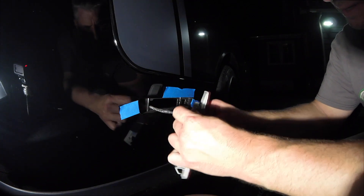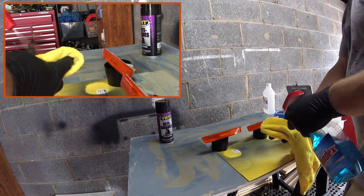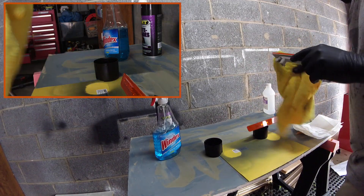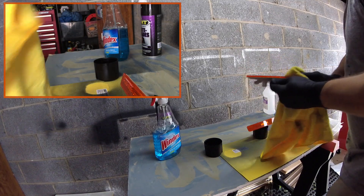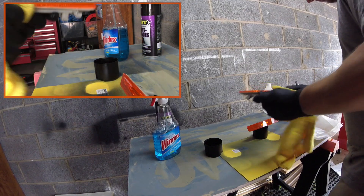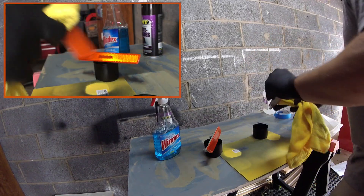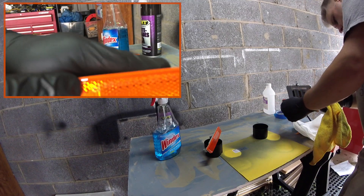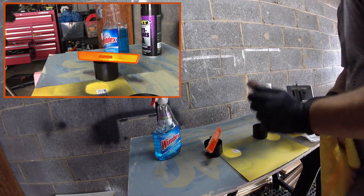Unplug it just like you did in the front, and simply repeat the process on the other side. We've got two layers of cleaning here. The first one is going to be some Windex, an ammonia-based cleaner — scrub all the dirt and goo off, anything that's sticky like road tar. I'm using a microfiber at first, then a paper towel. When you're cleaning and painting these, make sure the Mopar lettering and logos are on the bottom because you want to paint the top ridge nice and dark.